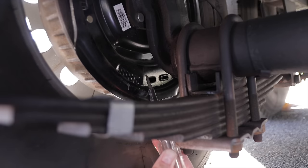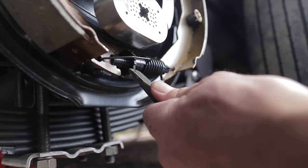Ours was a pain — because of the way our axle is set up, I even made a custom brake spoon, but it was still so difficult to get in there and adjust it properly. The auto-adjusting brakes eliminate that concern entirely. To adjust your brakes, you want the wheel to spin freely, then spin that adjustment from the back until it becomes really difficult to spin the wheel. Once you reach that point, back your adjustment off so the wheel can spin again. Leave it at that position — that's the earliest time the brake pad will contact the drum when you press the pedal. Properly adjusted brakes give you the best braking possible and prevent the pad from dragging and creating heat and resistance.